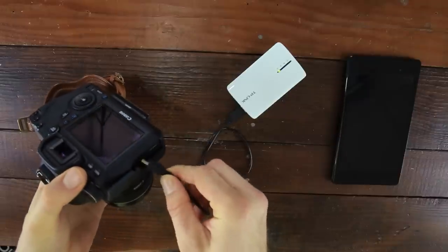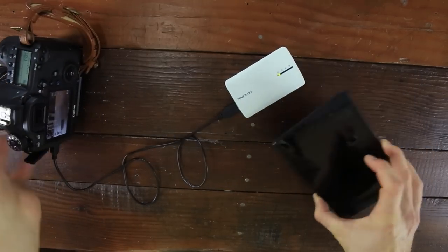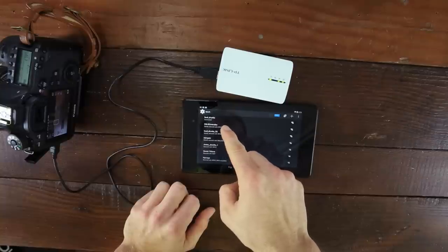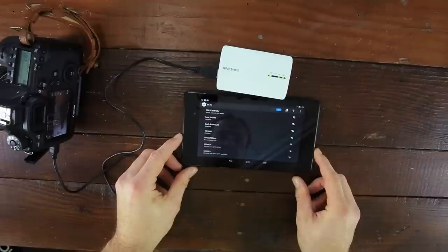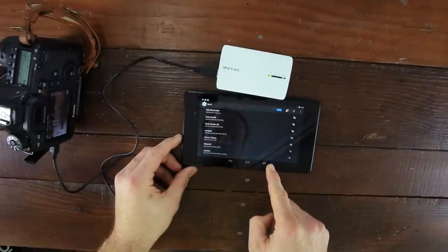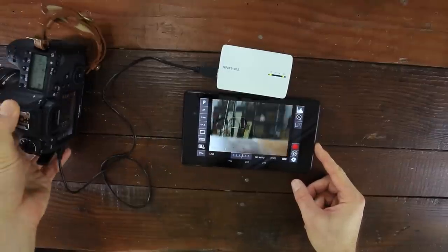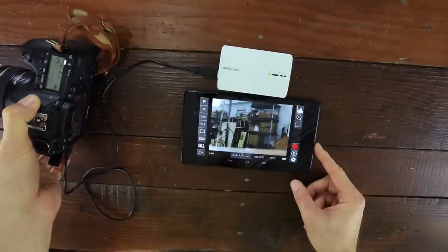So let's go ahead and plug it into the USB port on the Canon camera here. You can see that I already have it in video mode. Then let's go ahead and power on the tablet. If we look at the tablet here, you just need to find the wireless network that this TP-Link is using. Right here is DSLR Controller. Click on that — I've already got the Wi-Fi password programmed in. Hit connect. And in just a second, I should have full access to the TP-Link. You'll know when this starts blinking and you have a connection shown up here. Let's connect. There we go. I'm going to go ahead and hit home. Now here's the DSLR Controller app. Click on that. And you probably heard that click — that was my Canon DSLR turning on.